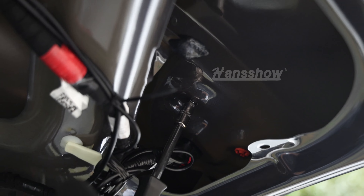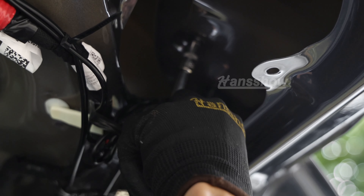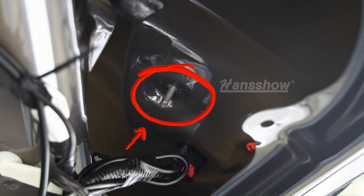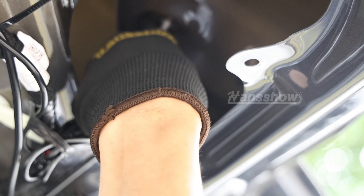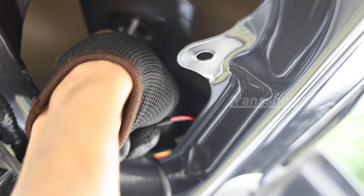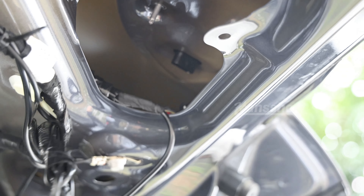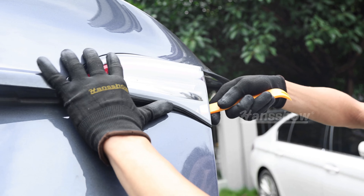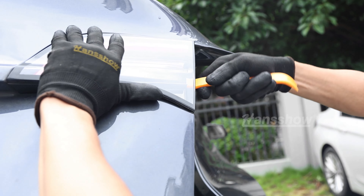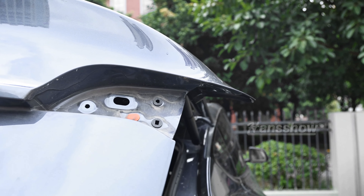Using the socket, remove the nut behind the inner tail light — there are 2 nuts on each light. Loosen with the socket or wrench, then completely remove with your fingers so the nut does not drop. Once you remove both nuts on each side, unplug the wire from the vehicle and the inner tail light. To remove the plug, pull the red tab out and then pull the plug out. Once you have both plugs out, use the pry tool to remove the inner light — you can use a little force, but be careful not to scratch anything. You may want to put tape around the tail light to protect the paint.